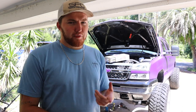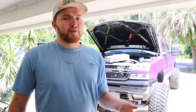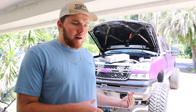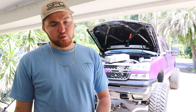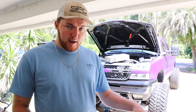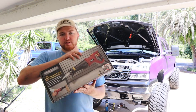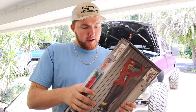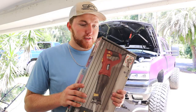After quite a few cuss words, a lot of yelling, hitting stuff, and just getting mad in general - I can't take the old manifolds out with the Y-pipe connected. I tried to get my electric impact on those bolts, they wouldn't come loose. Soaked them in WD-40, wouldn't come loose. Put a torch on it, got it hot, put my impact on it and it stripped the bolt. So I went to Harbor Freight and got a sawzall and some metal cutting blades, and just cut the Y-pipe off - then you don't have to worry about bolts.